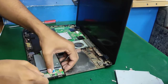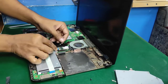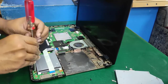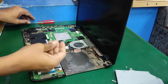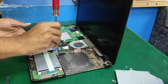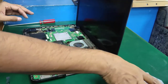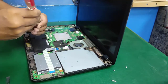Now close the I/O board, audio board, or USB board and add the power cable into the motherboard. Close the screw on the HDD board — this one screw connects HDD to motherboard. After done, add the ODD and DVD writer, close it, and close the screw.